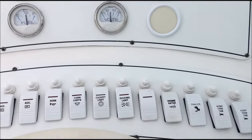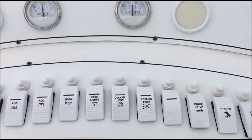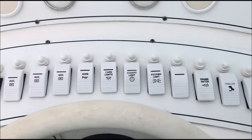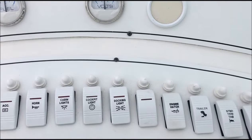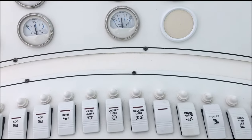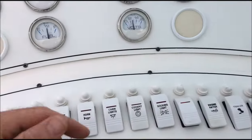One thing very important to remember, okay? Only select your Captain's Call feature at idle speed. You're determining how your boat's pumping out exhaust as well as the water, so it's easy to keep the engine cool. What turns the flappers in the Y pipes is thinner than a pencil, and they're aluminum. So if you're going wide open, maybe not the first time, but I promise you one of these times you will break them. So as long as you just select that at idle, you're good.